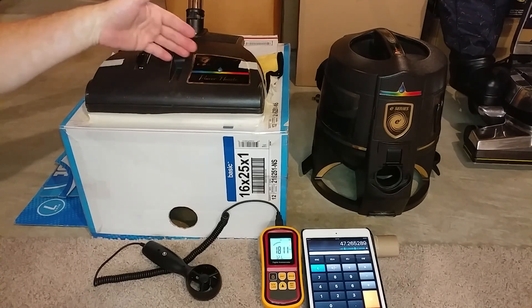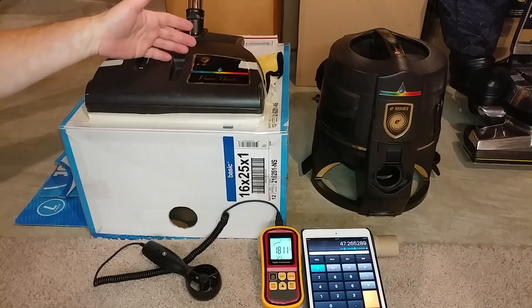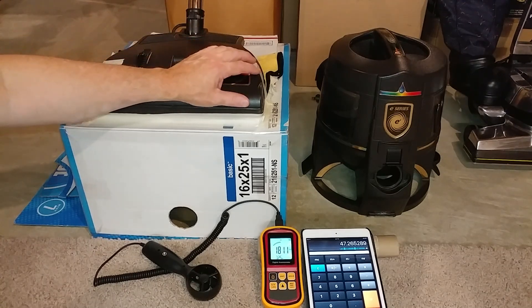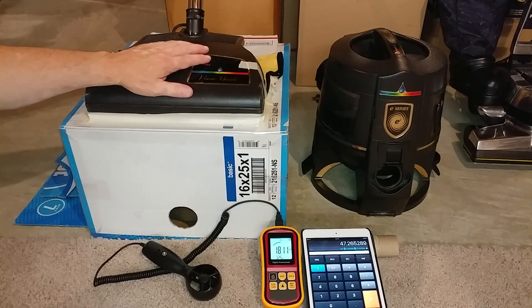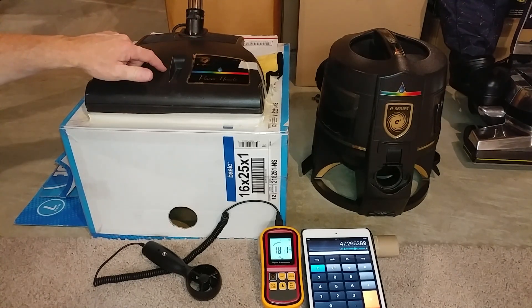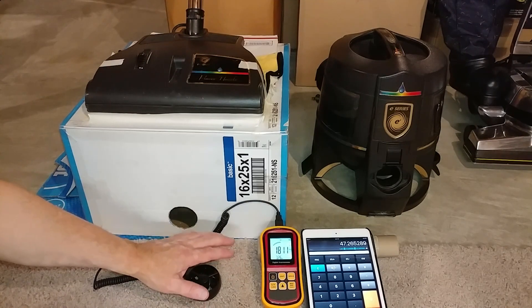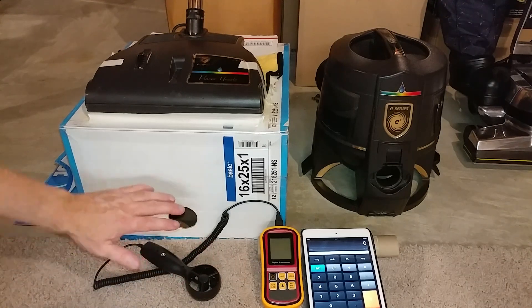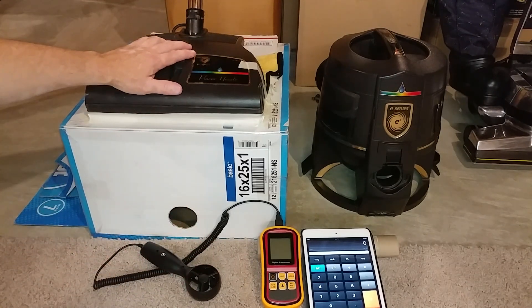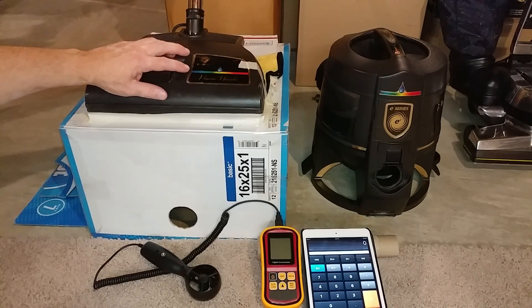Going to an E2 with this particular nozzle, you're looking at about 47 minus 33 — a 14 CFM increase. The rug plate opening is the same, so this definitely will clean better. I also noticed this thing is supposedly rated at about 2.4 amps, and when it's not on pile carpet it's only 600 or 700 milliamps. Let's re-run this with the nozzle spinning — Thomas tells me the motor in here might not be in great shape because it makes a real racket.